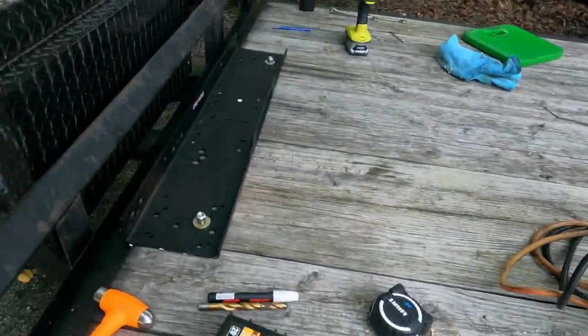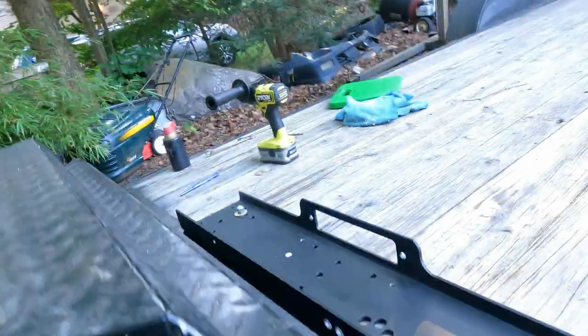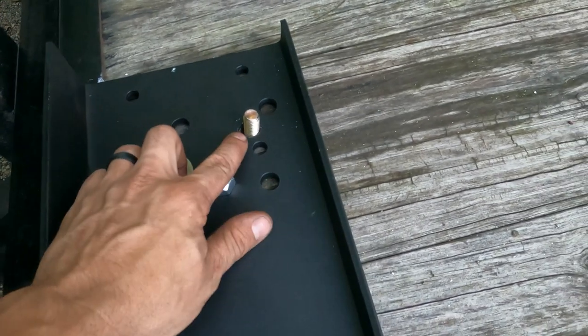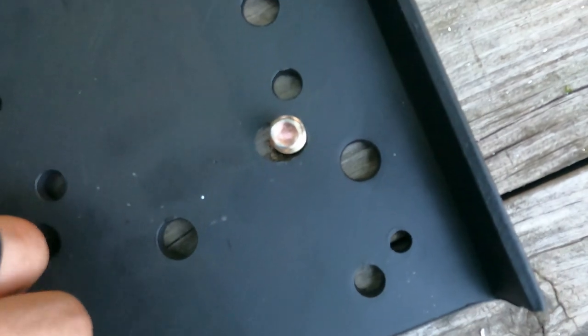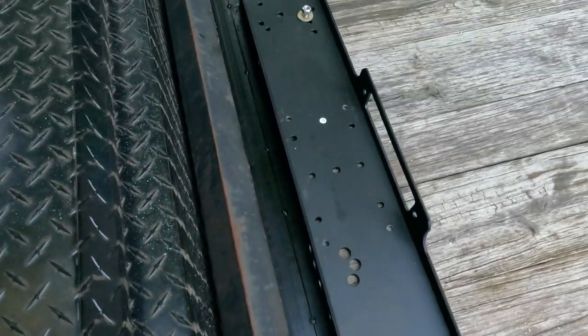And now I'm working on mounting the winch plate. I drilled holes here, and they go down underneath, to right there. And I drilled them too close to the L part of that angle iron. So the one on this side came up on too much of an angle, so what I ended up doing was I ovaled out these holes a little bit on both sides. You see, so now I can move this so I can make it as straight as I can. It doesn't need to be perfect, it's a trailer, but I like to at least look somewhat decent.